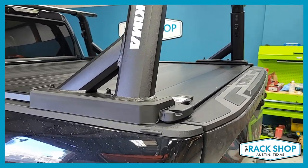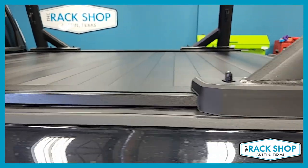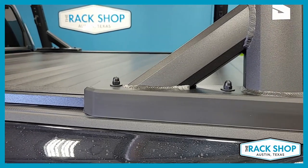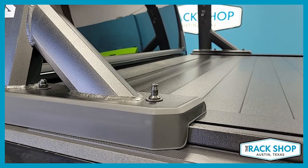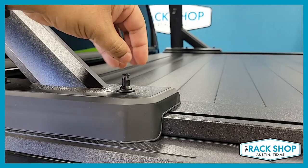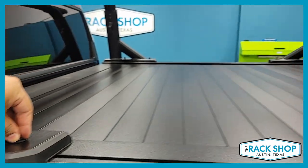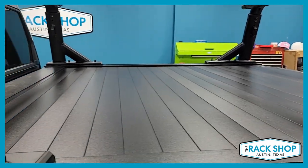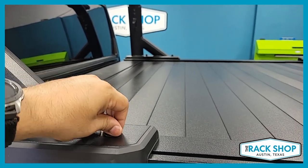With the tonneau kit, that allows you to mount into the T-slot. You've got two nuts here that hold it into the track. A little tip when you install it: make sure you don't over-tighten it — tighten it to the specifications because you can damage the tracks. In the front, there's a special lock housing included with your Overhaul system that sets on here and locks into place, with a second one on the opposite corner, so effectively each bar is locked down to the track and you can't access the fastener to unbolt it.